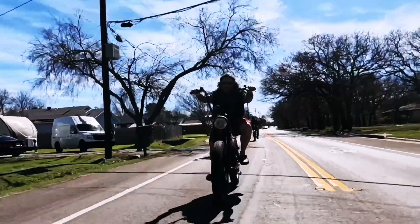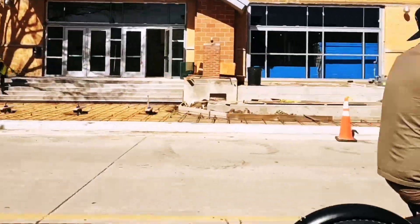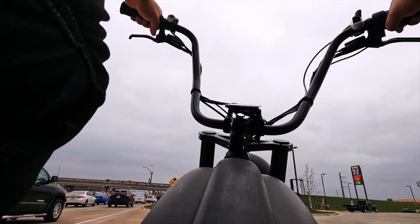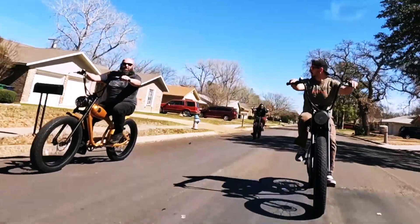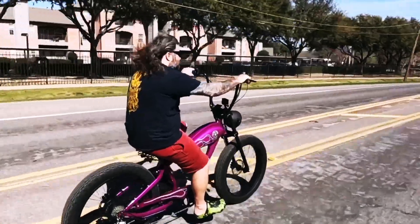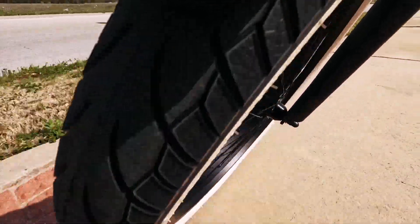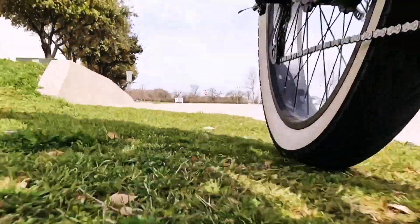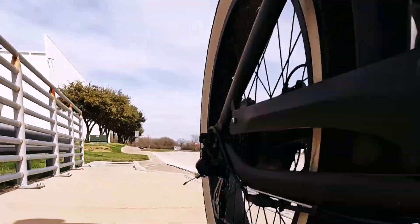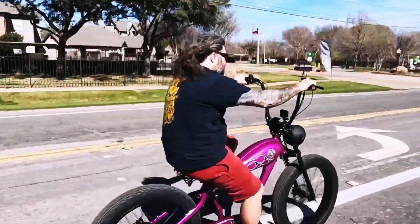Every little bit helps, and the more you ride, you will notice your own personal riding habits and develop a good feel for what actions and behaviors drain the battery faster than others. For most people, range will never be a factor as long as they charge up between rides. At the end of the day, range is basically infinite — you can always pedal home, as long as the chain isn't broken. If you treat your battery right, you should consistently get good range and expect your battery to last you 600 to 800 charge cycles before needing replacement. Just remember: pedal, shift, maintain speed.